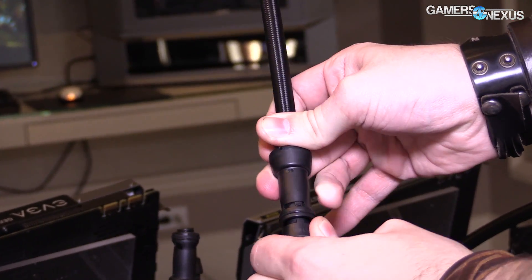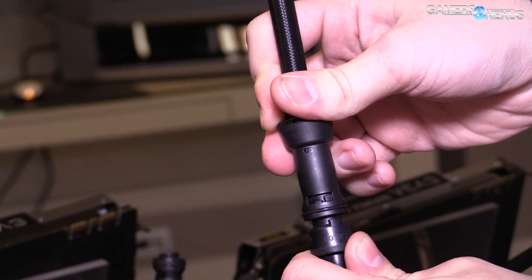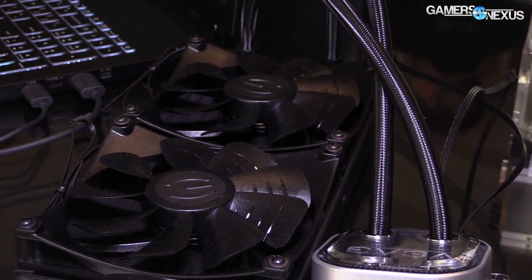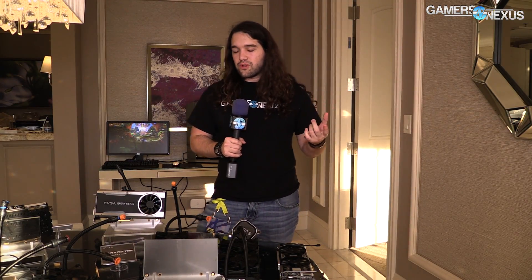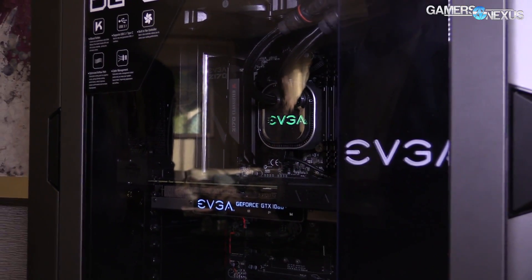For CLCs, we've got this — as the nameplate says, closed-loop CPU cooler. That is the actual name, so this is the EVGA Closed-Loop Liquid Cooler. It's got some features comparable in some way to the Kraken series that we tore down. Basically, it's a Gen 5 Asetek pump, same as the Kraken X42, X52, X62. The pump plate on top is RGB illuminated. It should, before launch, be able to support configuring the RGB LEDs and then disconnecting the cable while saving your settings — possible with a firmware update.